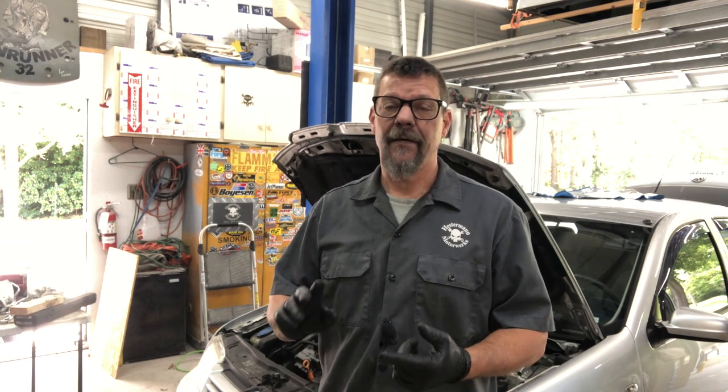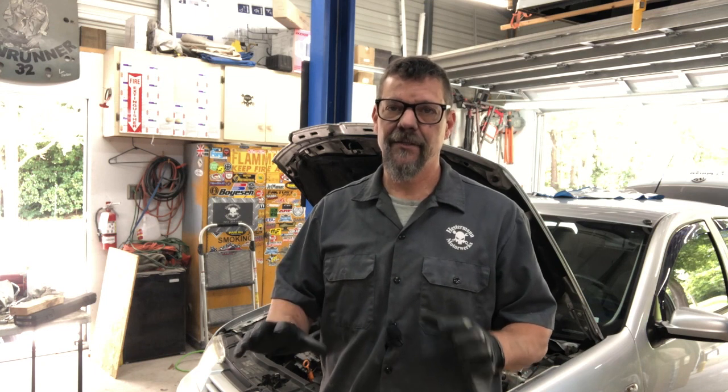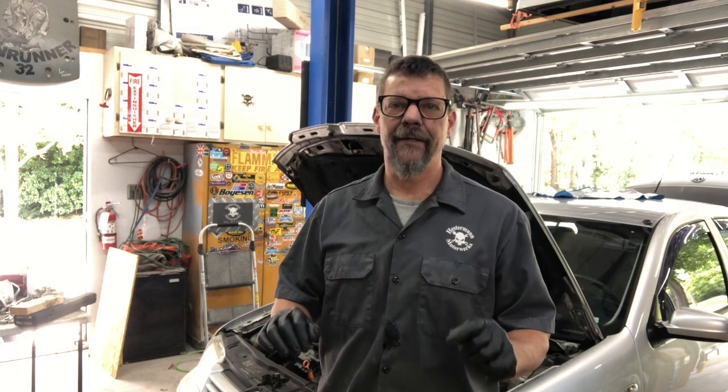clutch pedal and its lines. It has 2 hydraulic lines to get done. The shift cables and getting the shifter aligned. The power steering line, we didn't take it off, but there's going to be some conflicts, and there's kind of 3 different ways to address those. And a few other things, to include programming a TDI with VCDS to now be manual in the ECU.